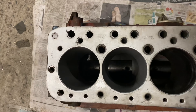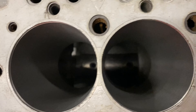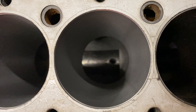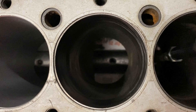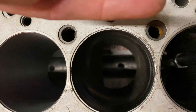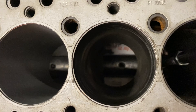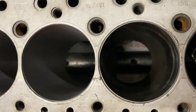That's the first two holes done on cylinder number four - if we have a look, that's nicely centered. Number three is not too bad. Over the center on number two - if you look closely, it's offset in that direction, so we don't actually need to offset that any further. I'll take some measurements across the middle and see where we're going to end up.